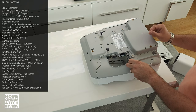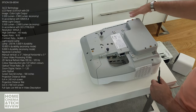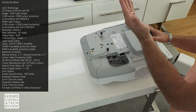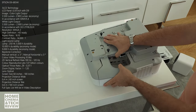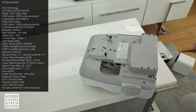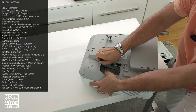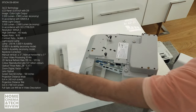So you need some sort of silicone-based foot you can adjust and stick up, or you can just buy some unit to give it a bit of ideal height if you're not going to use it on the ceiling. So I take this thing aside, just these two things are apart, and we need to remove this part. I found the piece inside. There's a single pin. You need to use a flat screwdriver and just push it toward yourself, and then it opens so easily, so you don't have to open these two covers.